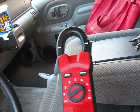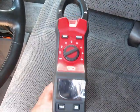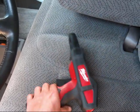So the meter is saying 41 amps — that's not bad at all, that's not even close to the 300. That was me leaving the alternator at idle, not revving it up. It really doesn't change when I rev it up because it doesn't need it — an alternator isn't going to put out its full potential if it doesn't have to. That's it guys, hope you enjoyed this little video. It's a nice little tool to have — $250, not bad at all. I'm glad I got to use it for free. In the future when I get another Audio Cue 3500 we'll clamp it again and see what she throws out.